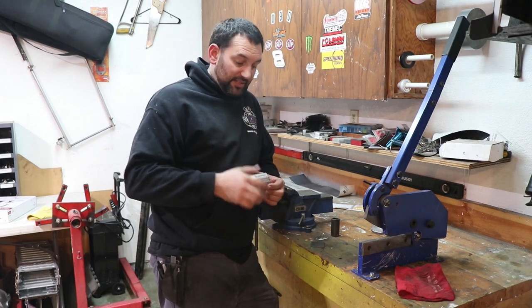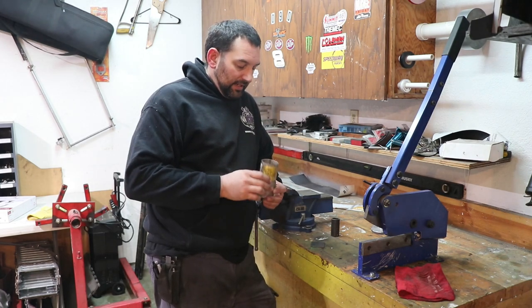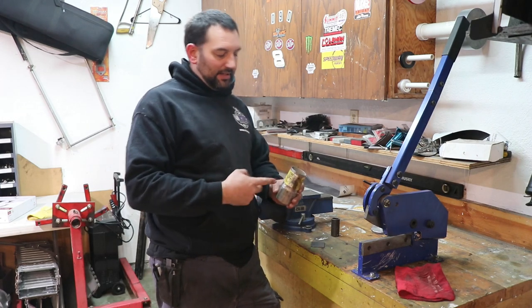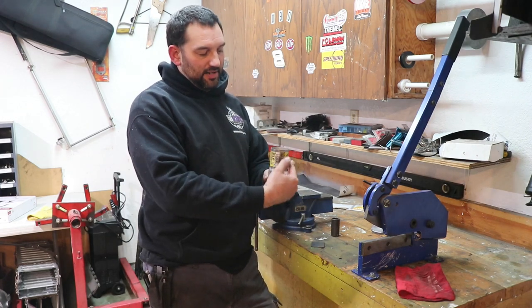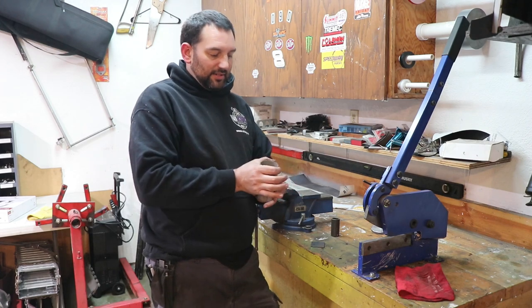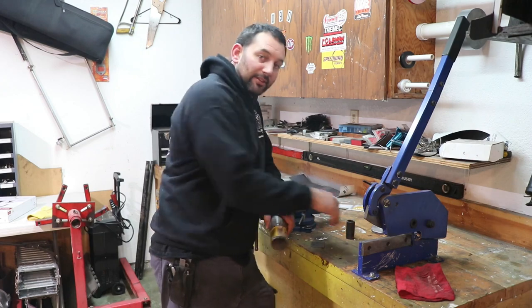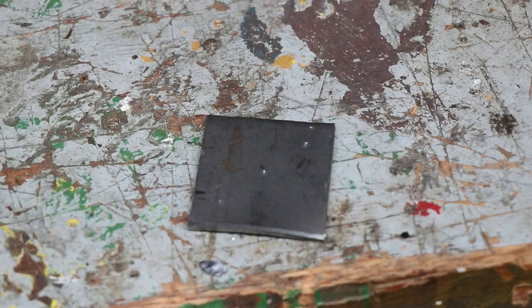And then I have this exhaust connector that starts out 2.5. I did check this fits the rubber hose real nice. And just to make it fit, I might have to cut it down a little bit to length, but my plan is I'm just going to notch some triangles out of here so I can compress it down until it lines up with this one and weld everything together. All right, I'm gonna start with the flange.